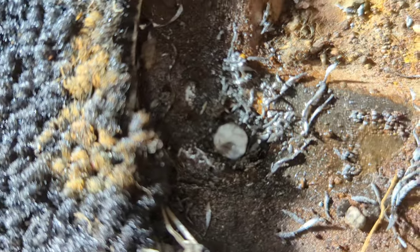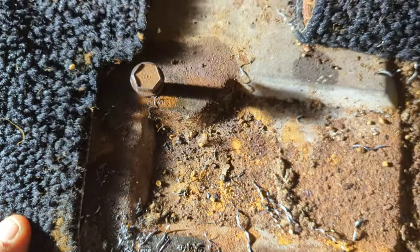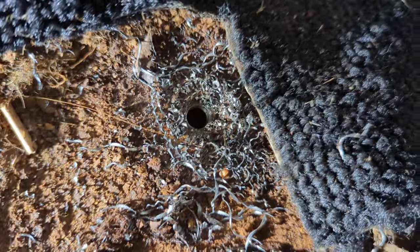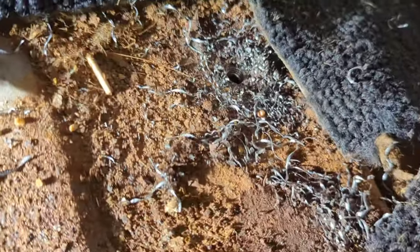This one is still broken off, and then I broke an extractor off into it, so I'm gonna mess with that in a minute. But anyway, the ones that were broken, I was able to sequentially upsize the drill bit, drill it all the way out, and then I tapped them to 3/8 coarse thread. So one there you can kind of see nice and fresh. The other one there, and then the other one is over there, nice and clean, brand new 3/8 coarse thread. So tapped it out. That worked pretty well.